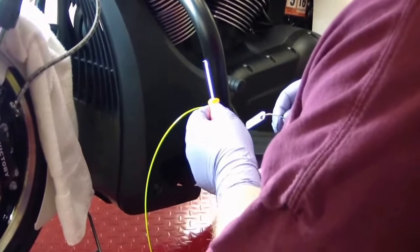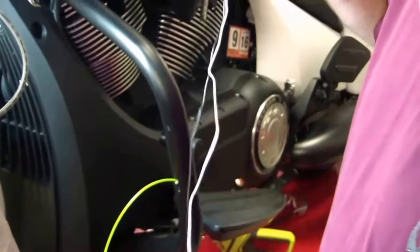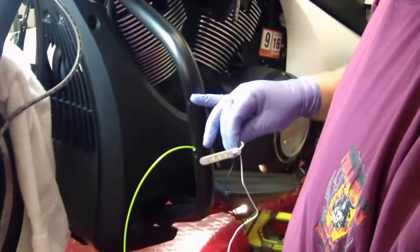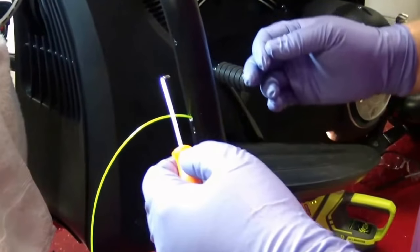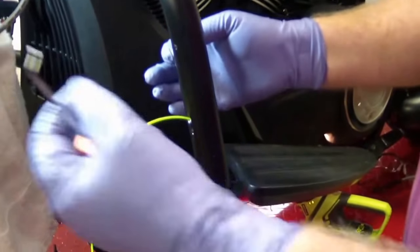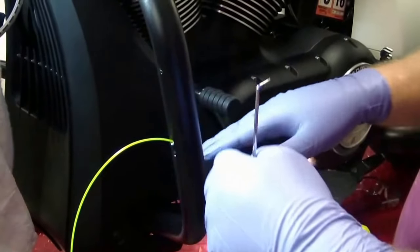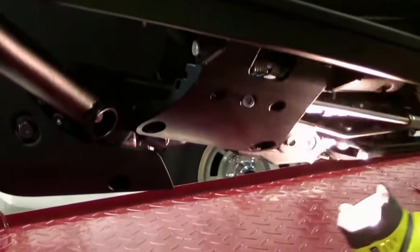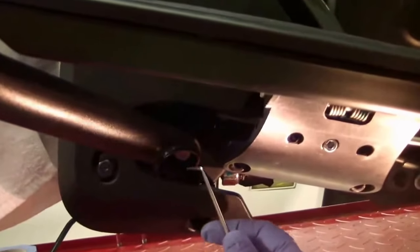The tricky part is coming. I've drilled all the holes but haven't tapped them yet — I wanted to make sure everything fits first. This is the LED board, and they give you plenty of line to come down through and come out, so there'll be no splicing inside. I wanted to feed a weed whacker cable through so I can pull my wires through, since they're so thin and light gauge they don't go through very well on their own.